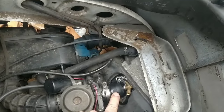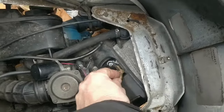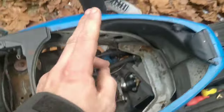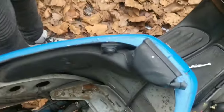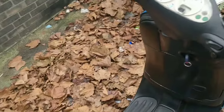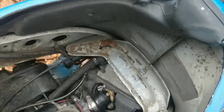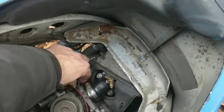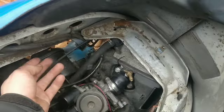All right, guys, new intake manifold on and seated. This needs blocking off. Sultan just said, what can I do? Sultan, you can block this off. So get a tiny piece of fuel tube, just a bit bigger than that. Chop it, but think about how you're going to block it off. Normally, you put a big fat screw in or something. That needs blocking off, and everything else needs wiring up. This don't matter. This is like the carb heater or something. They're not really used.